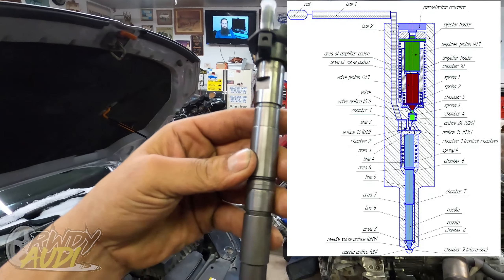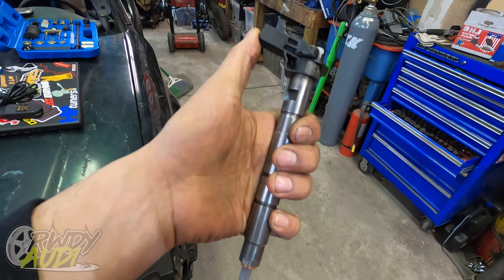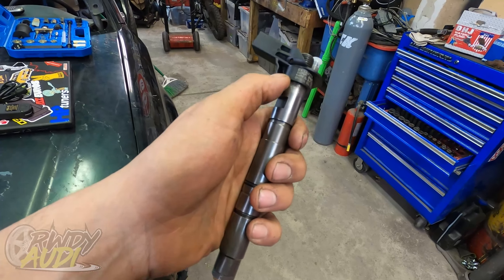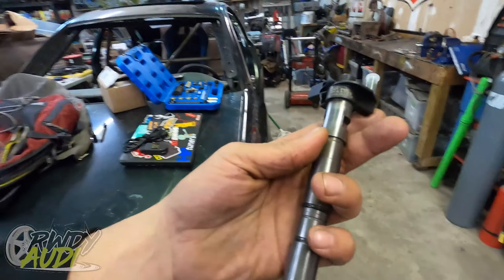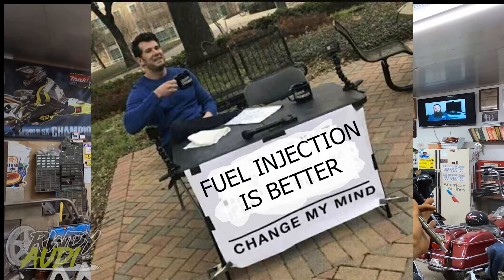Inside of these diesel fuel injectors there's basically a piezo stack. I'm going to pop an image here — this is a cutaway of a diesel fuel injector. The way I understand piezoelectric injectors and piezoelectric theory: the electricity that is applied here does not directly move it. The electricity applied through the injector goes to this stack, essentially making heat in it, and that stack moving is what actually drives this plunger up and down. Tell me I'm wrong — that's fine, I'm okay with being wrong.